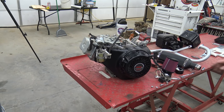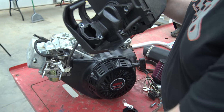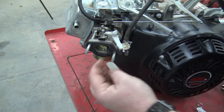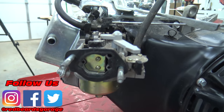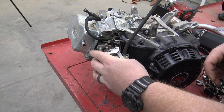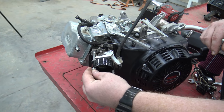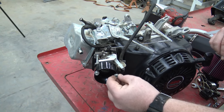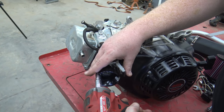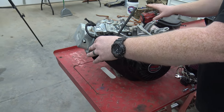That's pretty quick and easy. In this air box it has a kind of layout made into it. The older engines had this little spacer - it's kind of like a rubber coated steel. I keep these from older engines because when you slide them on, you can see it leaves the holes in the carburetor open. If you don't have one of those you might want to order one off Amazon for a GX390 - they're super cheap. Now we can slide this air filter adapter on from Go Power Sports. This piece right here is made to adjust out and hold your choke down because without it your choke would come right off.